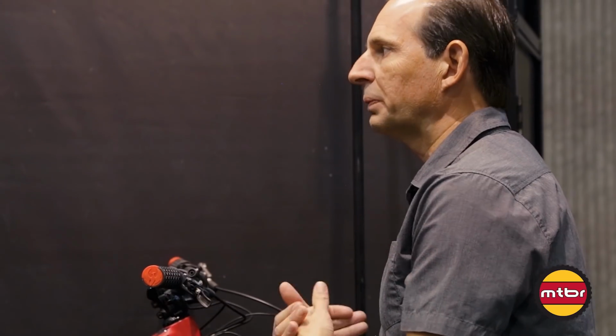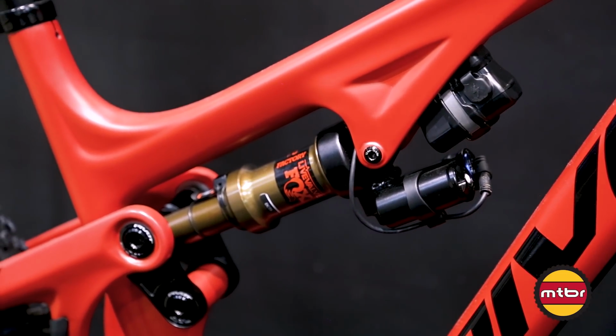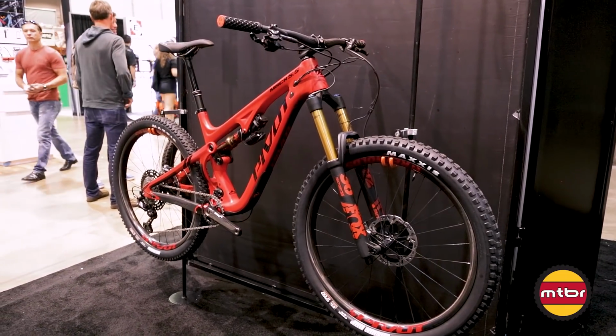It was a little confused on what was going on, and they came and tested with us, and we started adding things to the wish list and got the basics, on and off, better. But there were still places where sometimes the front wheel would tap something and the back end would open up when you didn't want it to. So it got the algorithms and the computer programming and the addition of pitch detection, so it knows when the front wheel's up or down. All of these things got added.